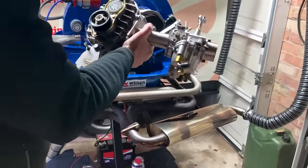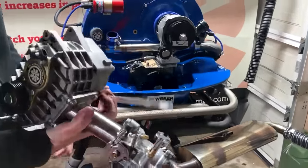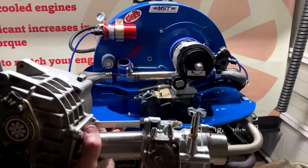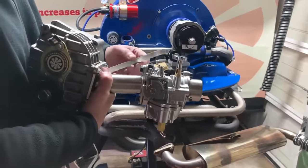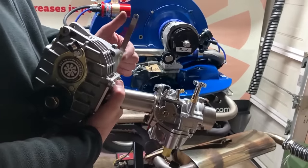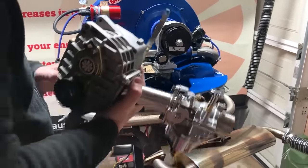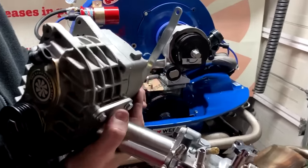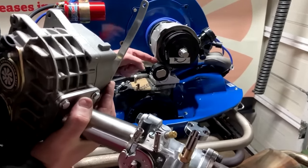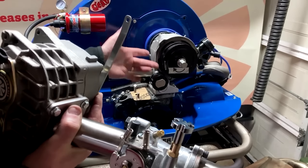You've got your carburetor and everything on there, your bracket, you've already put your gasket on. Key point here when lifting this on is to make sure that this brace bar at the rear of the supercharger is in the up position, so when you lift it onto the engine it's in the right place. Make sure that your pulley is sort of locked up in the up position. You don't want that loose because it'll get in your way, so just lock it out of the way